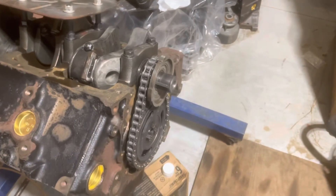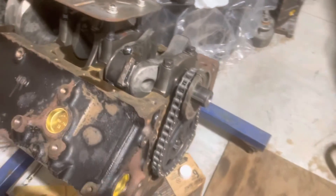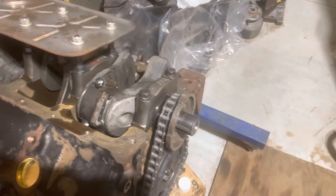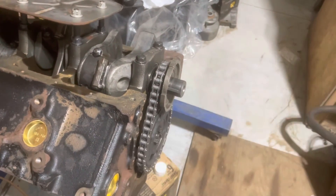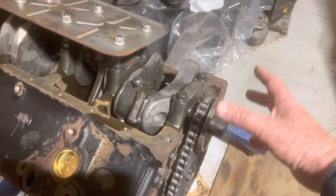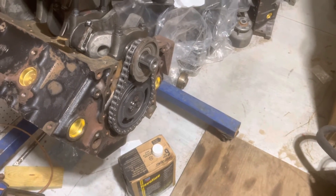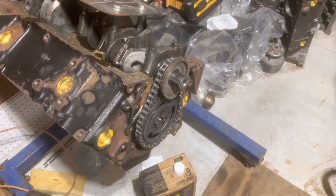If you have a carbureted engine you don't necessarily need the crank trigger itself, but some engines come from the factory with it in there and it spaces your front pulley out further so all your accessories line up. If you forget to put this on before the timing cover, they make a spacer that can go in inside the seal so you don't have to take the front timing cover back off. If you get an engine sealed up with the oil pan and front timing cover on, it's a pretty big deal to have to take it all apart to get this device in there. I'll put a link to that part in the description. Always read the description of my videos because I put extra information I might not have covered in the video itself.